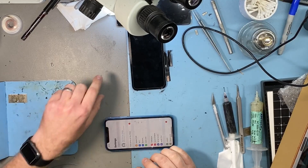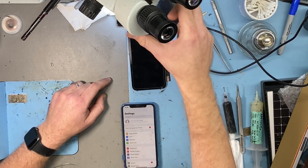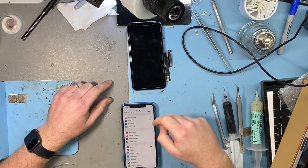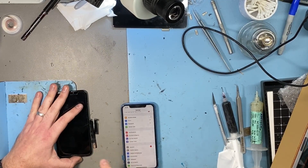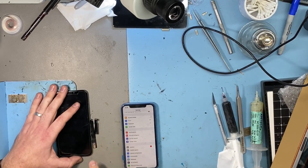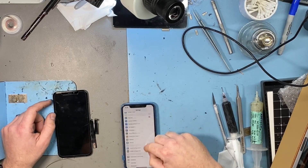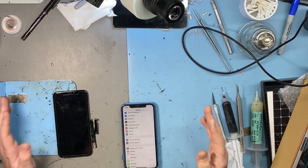Had this screen worked in the first place and had we fitted it and used it for the repair, there's a high chance that after an iOS update the touchscreen would have either stopped working completely, or it would have been half and half, or it would have been just completely erratic — which is what a lot of people are seeing at the moment. So the data that is stored within this touch panel IC on the original screen should be treated like a Touch ID home button. If you move that over to every new display then you will have no touch issues like we had with this screen here. So this screen, rather than going back to the supplier or being refurbished with another touch panel on it, is now perfectly fine to use. So there we go, take care guys.